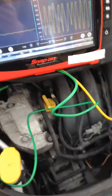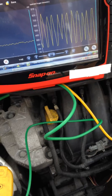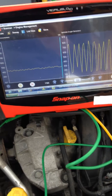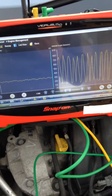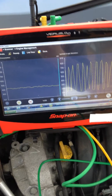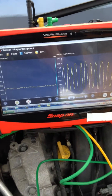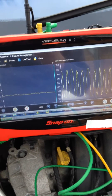Hi, this is Damian from BC Diagnostic Solutions. Today we're going to look at a 2005 Renault Scenic with a K4J730 engine. The purpose of this demonstration is to show the relationship between serial communication diagnostics through the dataline connector and parallel communication using an oscilloscope to test engine performance. We're going to look at the relationship between the manifold absolute pressure sensor and the exhaust gas oxygen sensor.